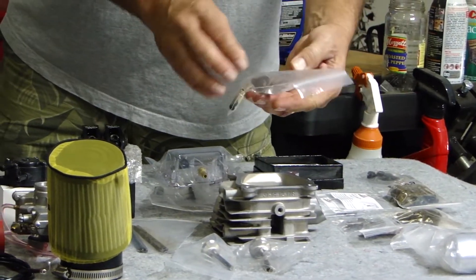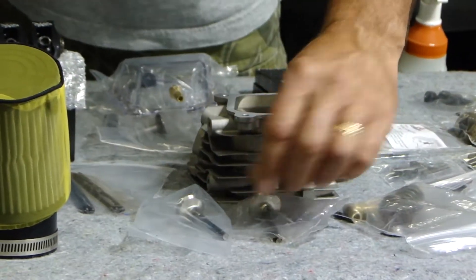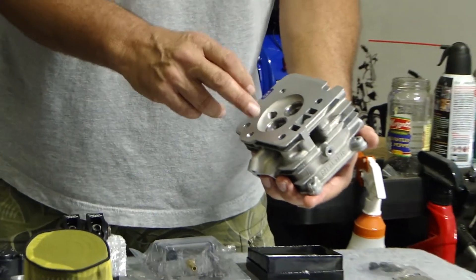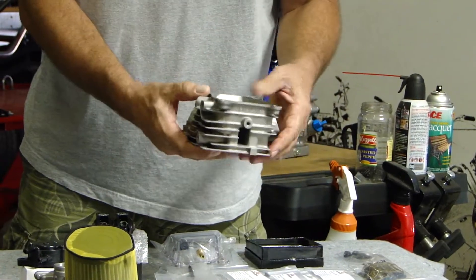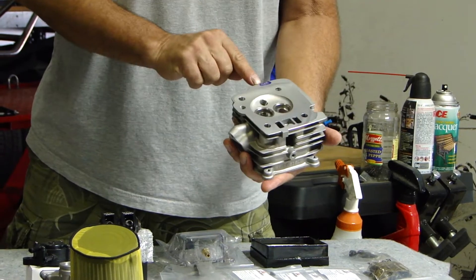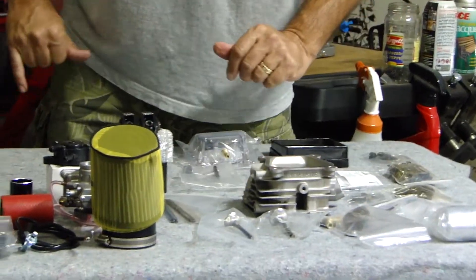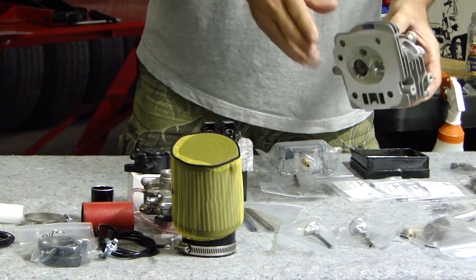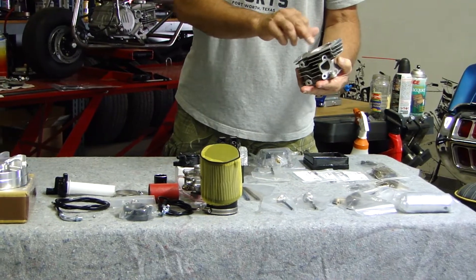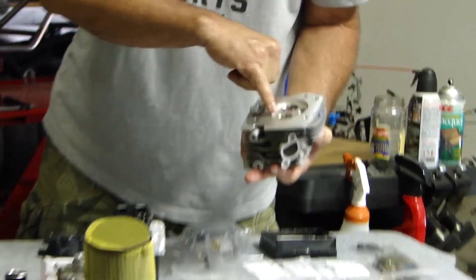Brand new set of valve springs right here — these are dual 40 pound springs. The head has already been machined for it. Brand new stainless steel valves are going in it. This is the stock big valve head from Go Power Sports, which takes 27 and 25 millimeter valves. It's the JT14-12-178 head, just milled 65 thousandths by our friends over at AZ Car Works. It's also been set up for the dual valve springs. I am going to go in and do some porting — clean up the short side of the intake and clean up around the valve area. We'll show you that in the upcoming video: how we take all the edges out, taper everything, clean it up, get a little better flow out of it.